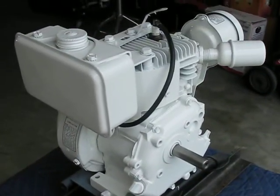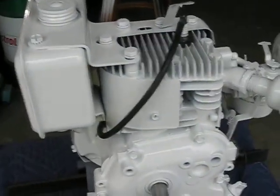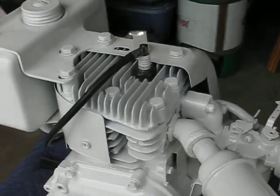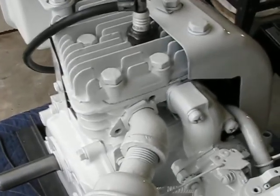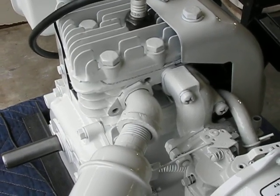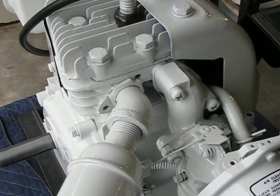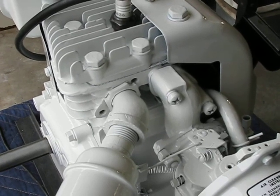It's been bored ten over. It's a steel bore. I use long life rings — you can get that option for these engines. Shaved head, four-angle valve job. Stainless valves, both sides. Oversized intake valve was installed, so the guides are tight.